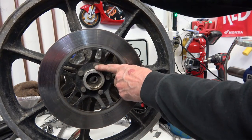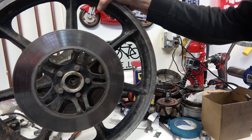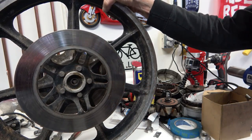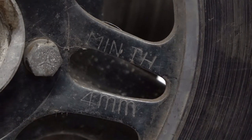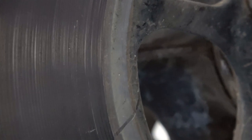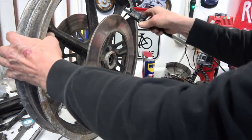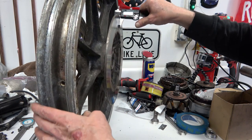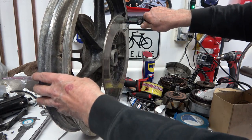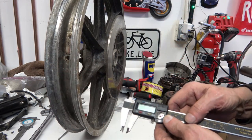As you can see, the bolts were wrong. The wheel — I believe it's a Lester wheel, but I'm not 100% sure about that. They took the regular CBX wheel and attached it to there. Written right onto the disc are the minimum specs that these discs can be serviceable. And as you can see, the discs were in really rough shape — very rusty, very marked up and weathered. Here I am miking the discs to make sure they're within the service range of 4 millimeters, and it ended up being just slightly over 5 millimeters, so these are completely serviceable.